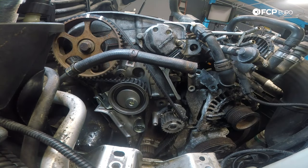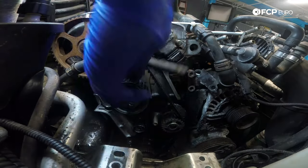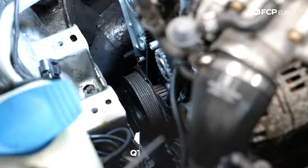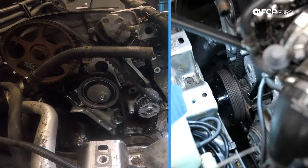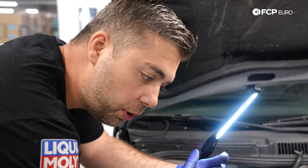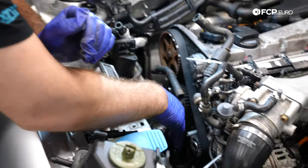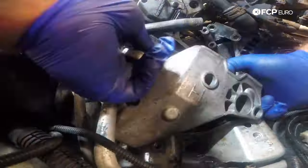So I put the bottom crank pulley on. I'm going to spin the engine over a couple of times. We spun the engine over twice. We verified that all of our timing marks are in line. Now we're going to start putting this back together and we're going to start with the engine mount. I'm going to jack up the engine again slightly because we had lowered it, and we're going to go ahead and finagle that bracket in. It's going to be a little difficult to get in — it's this AC line that gets in the way along with the body of the car and all the timing components.